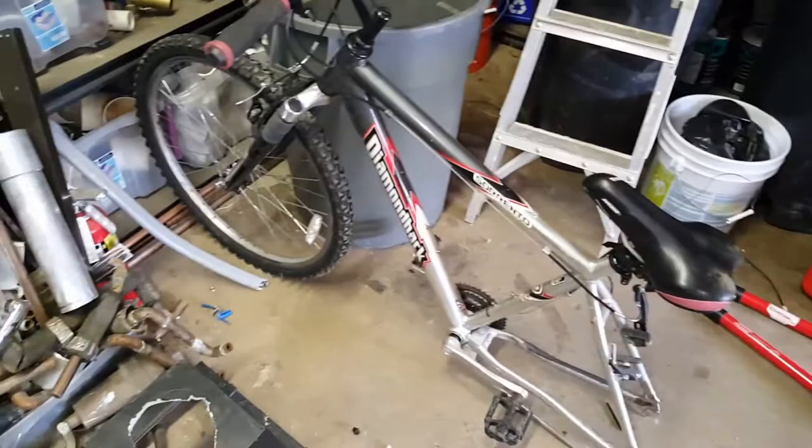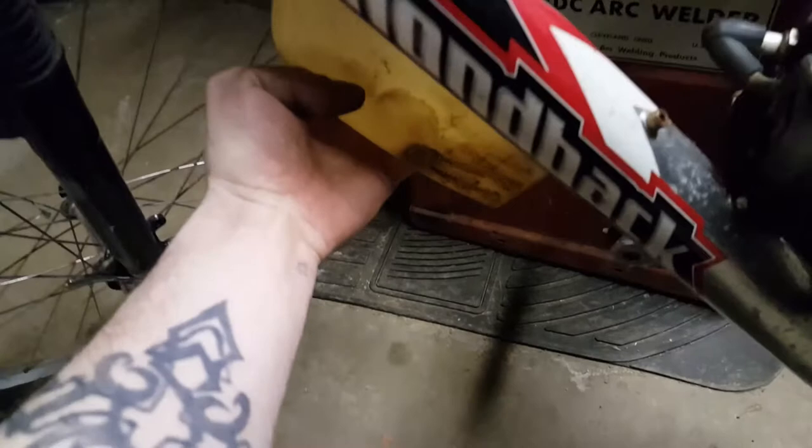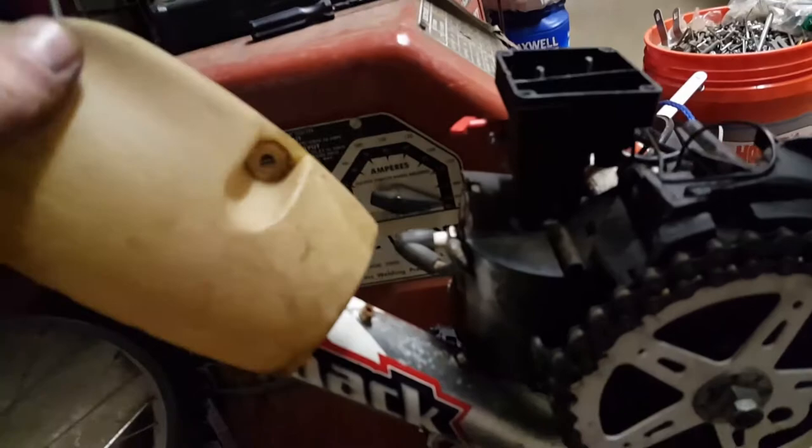I have a gas tank here somewhere. Oh, here it is. Oh man, the bike moved. That's weird. Anyways, this tank, I was thinking about mounting right under here, just like that, so it clears the front tire, and the fuel doesn't have far to go to the throttle body. It's going to be hard to feed it down. I'll probably have to do it like right here. Honestly, I don't know how to set that. I'll probably do it like that so the gas can feed straight over and I'll have easy access to the tank. Actually, yeah, I think I'm going to self-tap that right there.